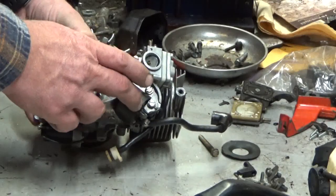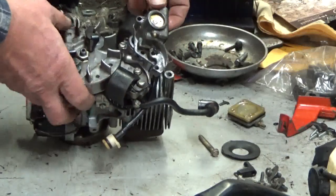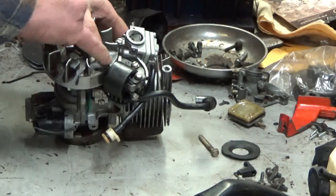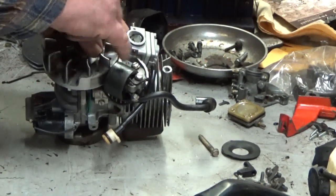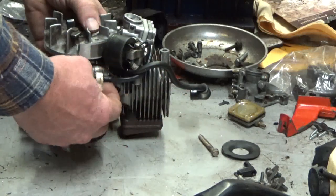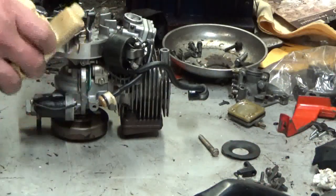Okay. So, a quick overview. You've got your flywheel, your coil, carburetor. Carburetor has a casting on it. It goes underneath the coil. There's a couple insulators. They're just a nylon insulator that the screws go through, and then a couple of nylon washers underneath here, or phenolic or something. Make sure you get those in place so this coil is properly isolated, otherwise it won't fire. Your fuel hose comes down underneath. That is your tank fitting. That connects up to the fuel tank right here.